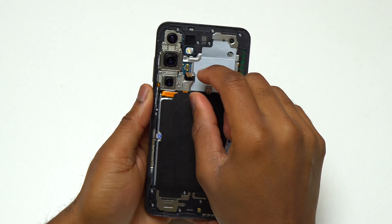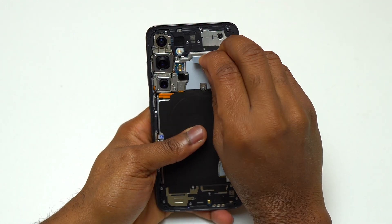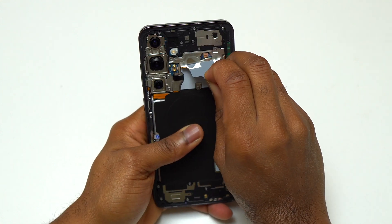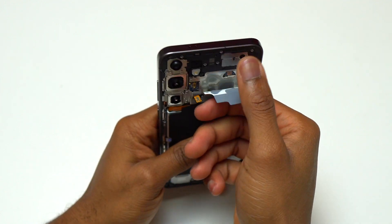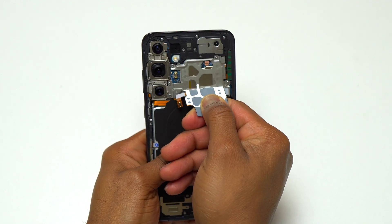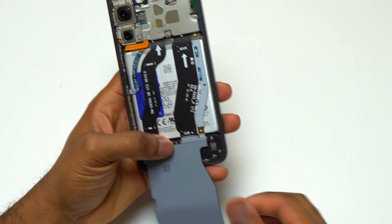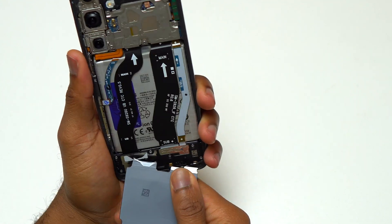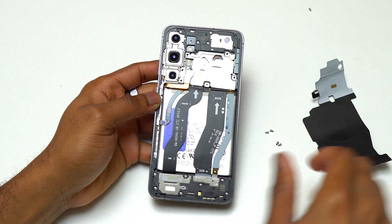Right now we can see only a small part of the battery. We need to remove the wireless coil. This is the cable that I disconnected from the motherboard. Then I started pulling from the top going to the bottom. This is the wireless coil of the Galaxy S24 Plus — you can either pull it this way or remove all the screws, then remove the metal plate plus wireless coil plus the loudspeaker at the bottom.